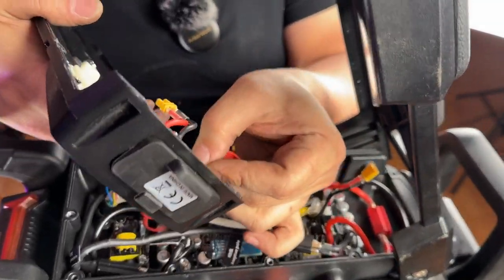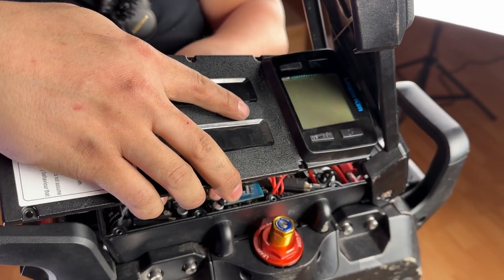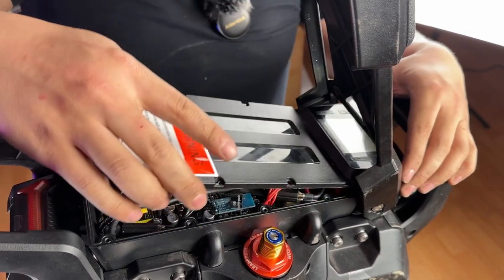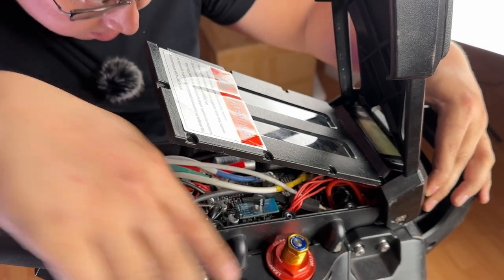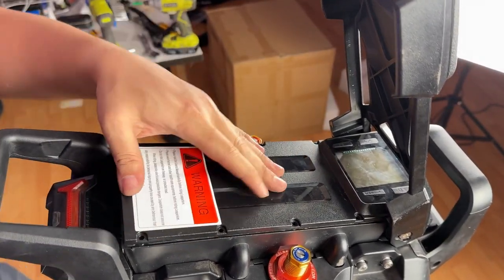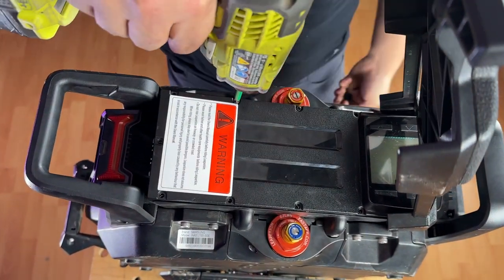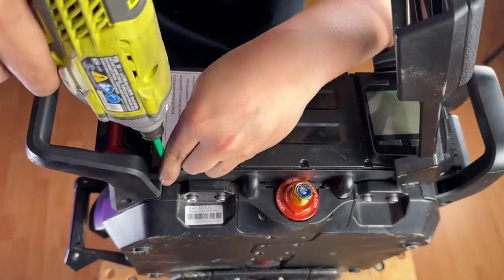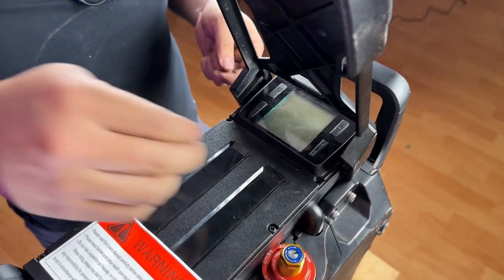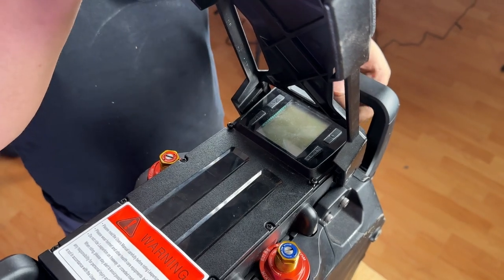Next, plug back in the control board cover — there are two plugs. As you slide back the control board cover, make sure nothing is getting pinched. If you need to use zip ties to secure your cables, please do so. Double-check the position of all your wires, then place the cover down. To reinstall the 11 black Phillips screws, similar to removal, you may find it challenging — I like to put the screws onto the perch first and then reach with your Phillips through the seat to access the head.